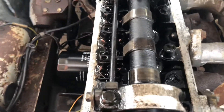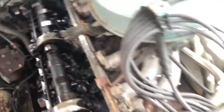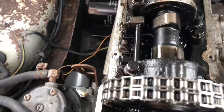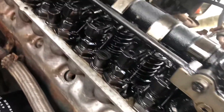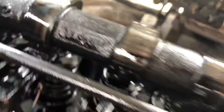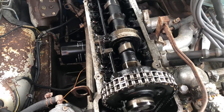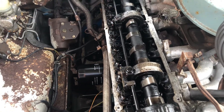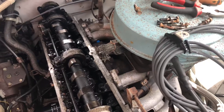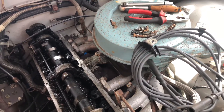At this moment you can see the engine is working but it obviously has lots of buildup on it. That's how it looks. Okay, let me put the cover back. The next step is the carburetor — I'm gonna remove it, open it up, have a look, and clean everything up.